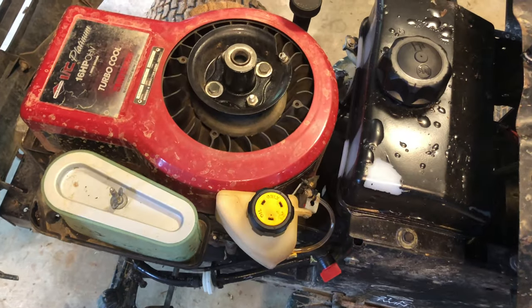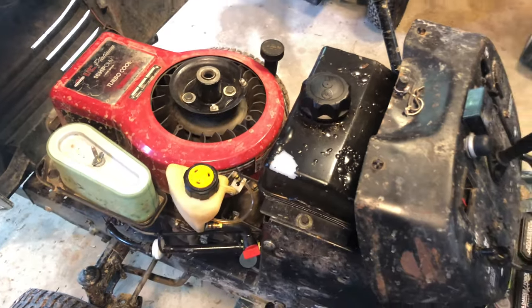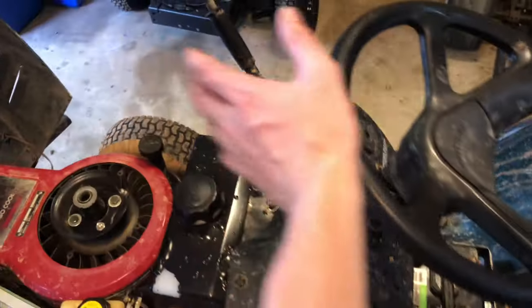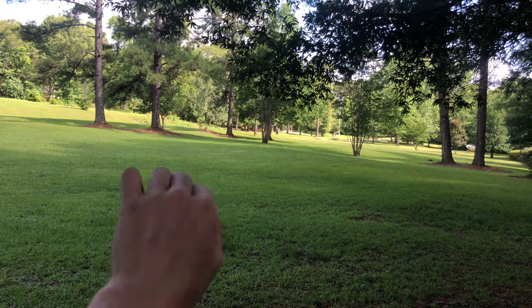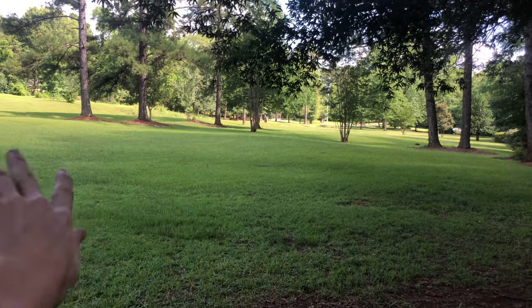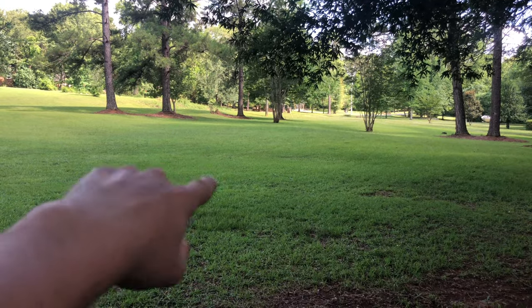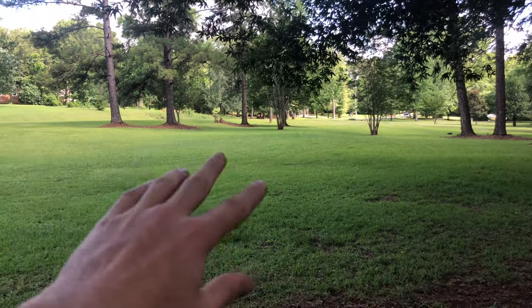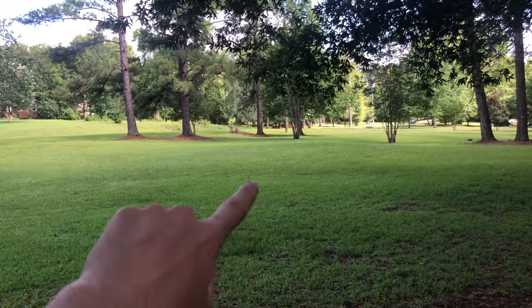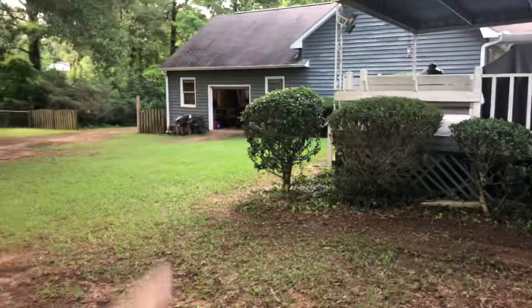This modification really depends on what you want to do. If you like bells and whistles and you're driving long distances, it's a good option. I've actually had to use it — I didn't check the fuel and got stranded in the front yard. Luckily I had some fuel in the auxiliary tank, flipped the switch, let it prime up, and had to blow on the top to force fuel into the carburetor since there was only a little left and not enough gravity to push through. But I started it up and drove it right back to the garage.